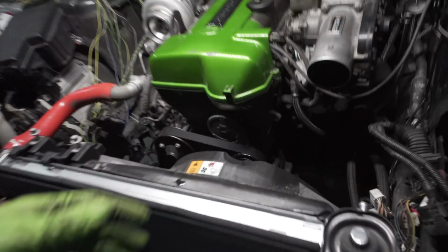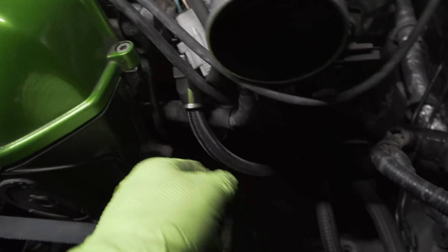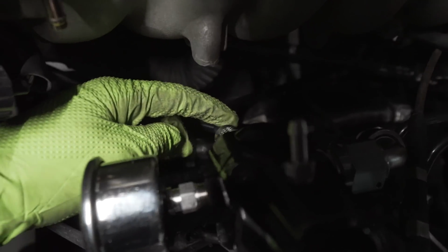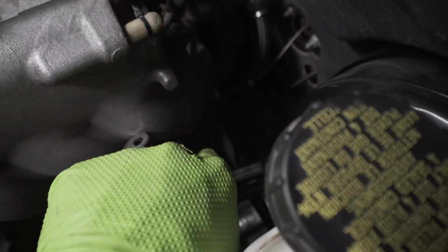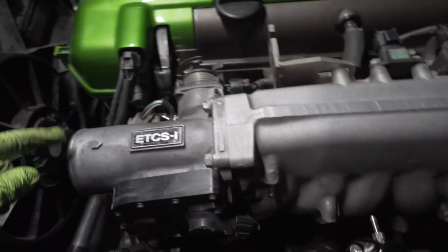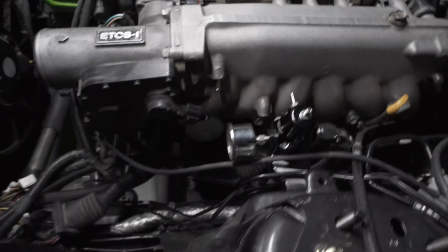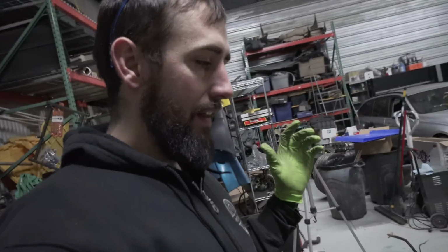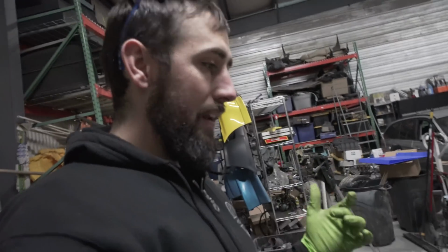And the other major thing I did is I actually got these fuel lines all made. So an AN coming out of the fuel rail to the return 6 AN right there, going straight down, and then we have straight out of the fuel filter back there up to this AN right here, little 90. So basically it feeds, goes right here, regulates it, and then sends it back. So got a fuel pressure regulator on there, and got all the lines made. So that's kind of a big weight off my shoulders. Those things were kind of a pain, and now we could actually start plumbing stuff.